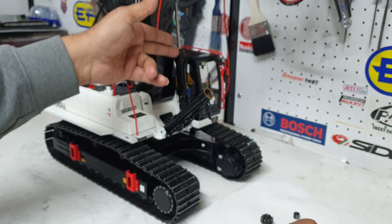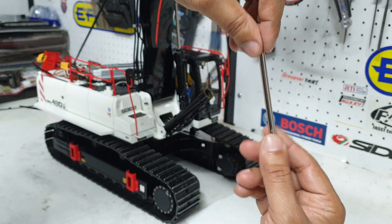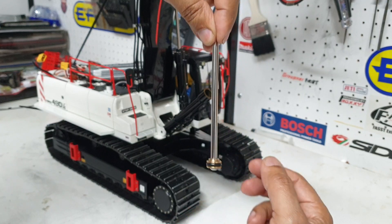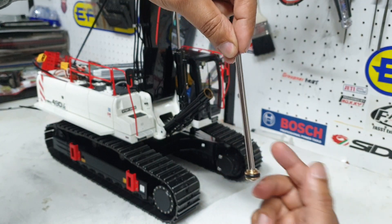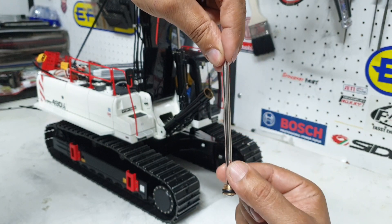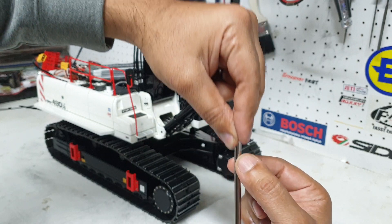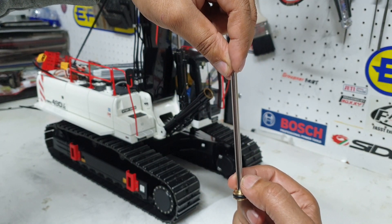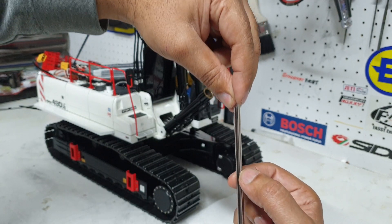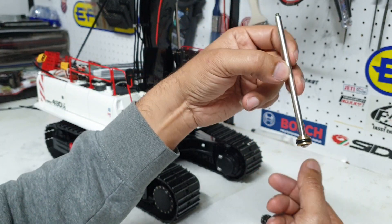One cylinder has been completed, secured back into place, and now I'm working on the second cylinder. The trick is you hold this part either in the pedestal drill in the chuck like this, or if you have a hand drill, put some dabs of autosol and hold a cloth and keep going up and down in a very fast motion. If you want a smooth finish, the RPM must be very high and the cut's got to be very quick. Very high speed and a very fast travel will give you a nice smooth finish on the cylinder.